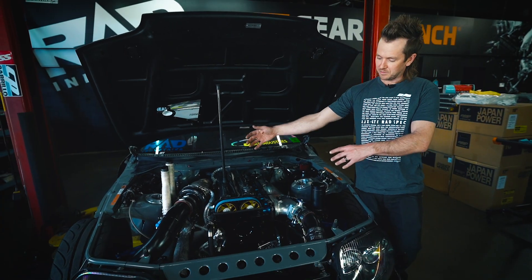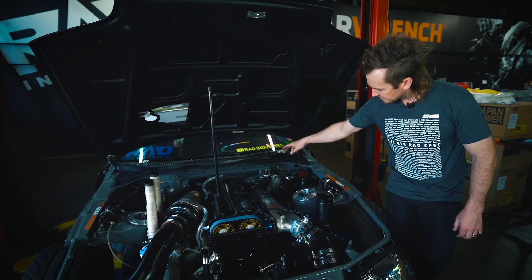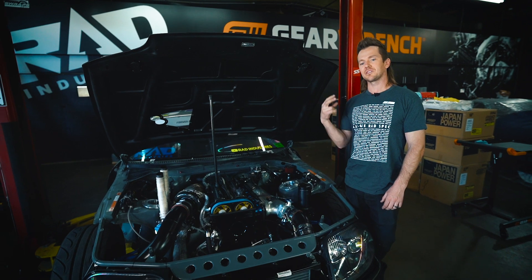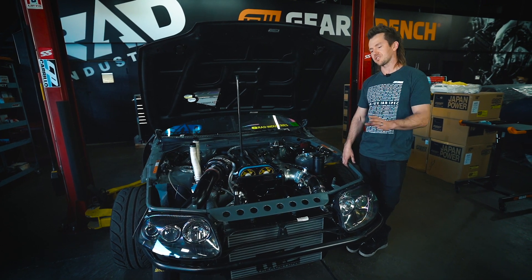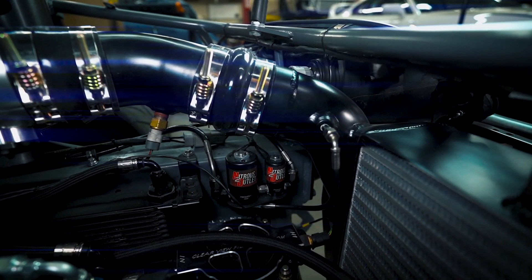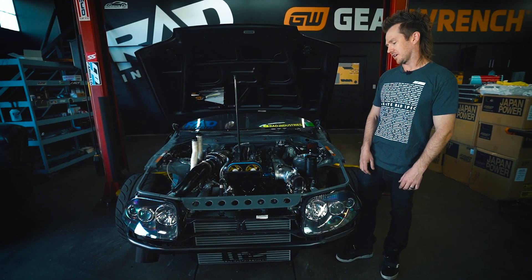We do run a blow-off valve — it's the recirculation one by Turbo Smart, so it just recirculates back into the BorgWarner housing. It's called their compact. Moving over, I run a HyperTune intake manifold with Deatschwerks 1500cc injectors through the HyperTune rail, managed by a Turbo Smart fuel pressure regulator — the FPR 1200. We feed that with two pumps. I run a Radium surge tank: there's one feed pump for the surge tank and then two fuel pumps. We're always good on fueling, keeping good pressure all the way up to 950 horsepower. We also started running a Nitrous Outlet nitrous system — it's a dry shot, sprays in just before the turbo for spool, so it helps get low-end torque and fully spooled before 4000 RPM. When the nitrous is on it's a 100 shot, just to get us going.